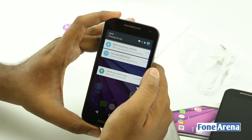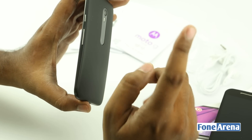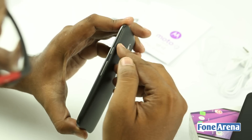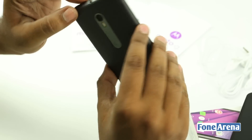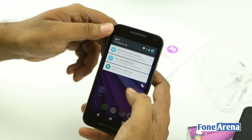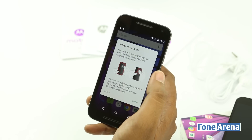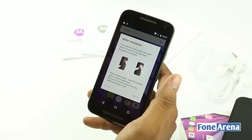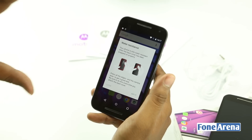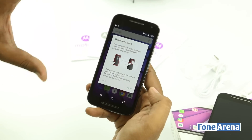Check your back cover — make sure it is well fitted. That is because of the IPX7 rating. As you can see it doesn't fit exactly well here; you have to push it and clamp it down so that the IPX7 rating is maintained. That's the main reason Motorola is asking you to check your back cover. Tapping it, you can see it shows the water resistance information. You have to completely snap the back cover properly so that the IPX7 rating holds.